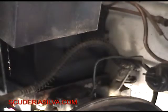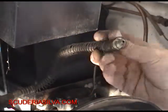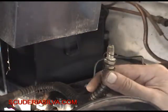Now we can take the hose loose. We've got the hose loose from this end and we notice that it has a male end on it. This other connection I've loosened — we can just spin that one off. This is the hard metal brake lines left and right here for the rear axle.